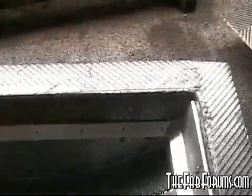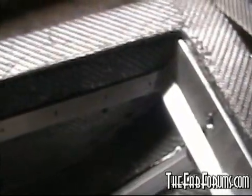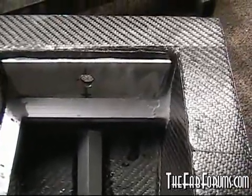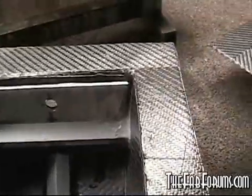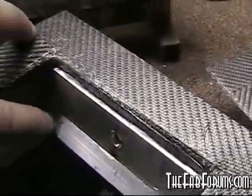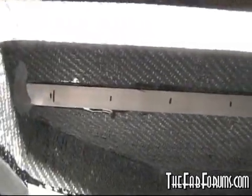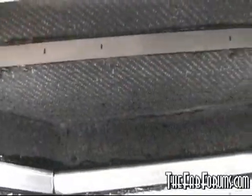I did a plate across the back and while doing that I had a good idea. I had to brace it along the back, but I figured if I had to have that back there I wanted to do something trick with it. From the inside you only see one hole — that's tapped for my vacuum line — but there are two holes back here. The other one is under this epoxied bracket, sealed, with a 90-degree channel that runs down the length of the intake. I've marked it, and these holes are strategically placed right over the ports of the lower.